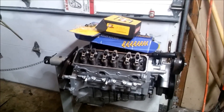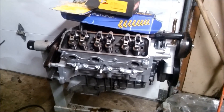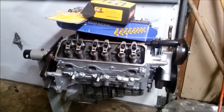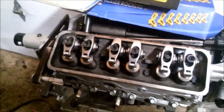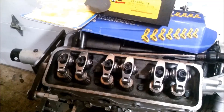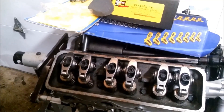Here is what you have to do. You're going to have to make the engine an adjustable valve train, unless you can get someone to measure your push rods - then you don't have to, because the cam base circle is different and you have to be able to compensate for it. The '95 to '99 heads have a different size stud in them - rocker arm studs. These are 10mm on the bottom. The 2000 and up have 8mm, so you really don't have to do much to make them fully adjustable.